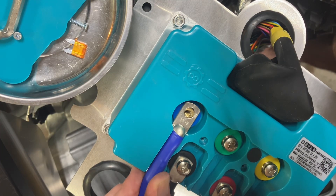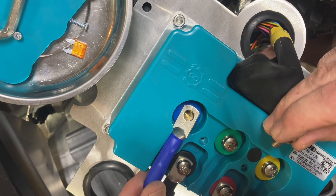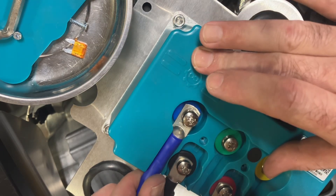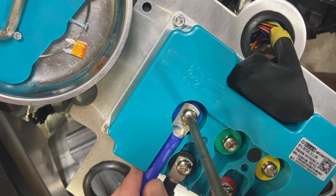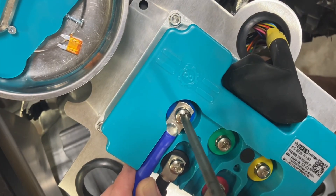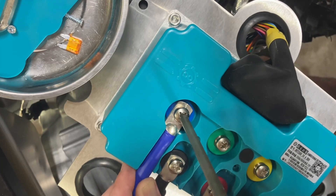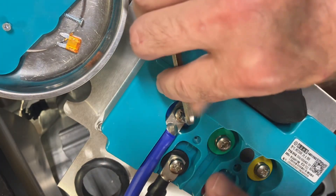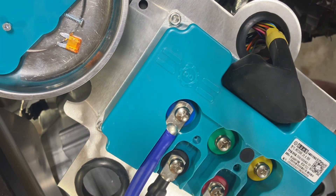When you go to connect your phase cables to the controller, you'll notice it's kind of wide and you can't get the screw in. The trick is to leave it up, turn it, and get the screw in a couple of turns, then let it sit at an angle. Let the screw force it in — it'll dig into the plastic on the controller, but that's okay, it holds it real tight. Then come through with a 90-degree screwdriver for more leverage and give it a good crank down.